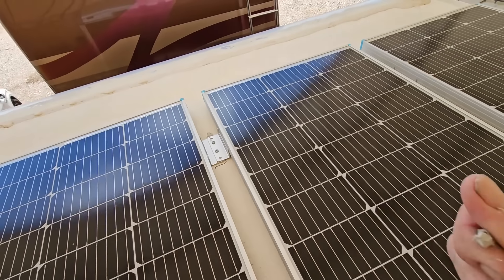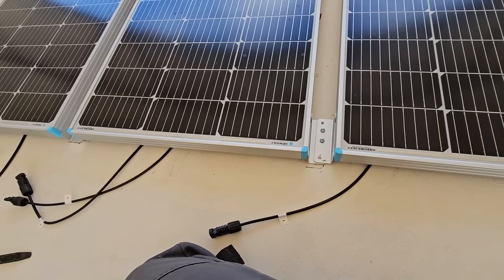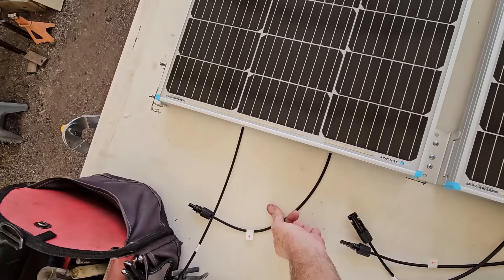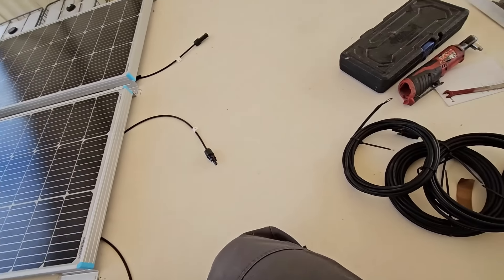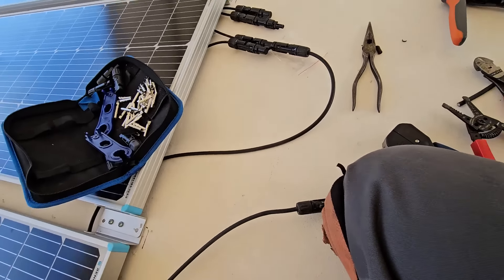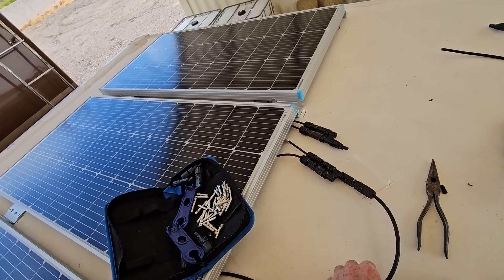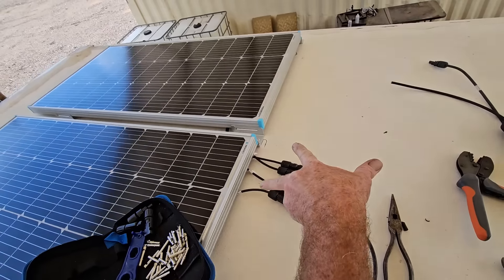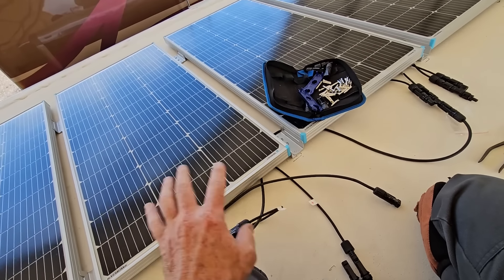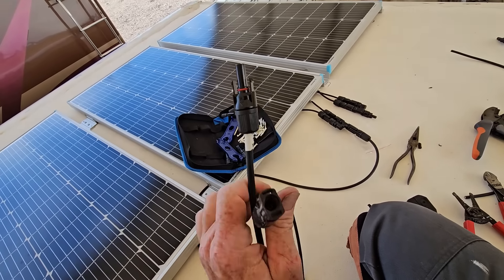The structure on this utility trailer is steel, so we'll drill new holes and put the screws in — stacking feet down, sealing underneath and on top, drilling holes, and dropping wires in afterwards. I've switched out to longer self-tapping screws. Before I put sealant over the top, I'm going to wire this up so I don't get wet sealant all over my hands and knees while routing wires. This one panel will be by itself, and the other three will get tied together using some Y-connectors.